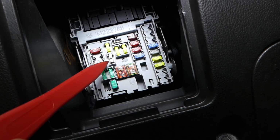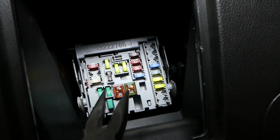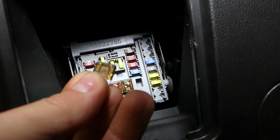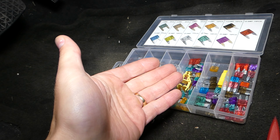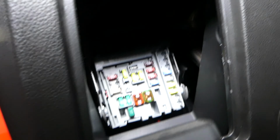And then we have fuse number 5. Fuse number 5 is actually for the information screen. So let me pull this one, and I'll look through the fuse, and you can definitely see it's burnt on the inside. So I'll get a new fuse. In the description of the video below you can find where we buy all our fuses from for a really good price, so please check it out. And I'll just get another fuse, and see if that is going to heal our problem.